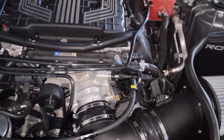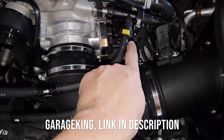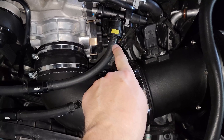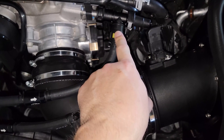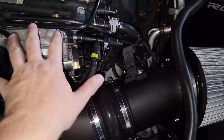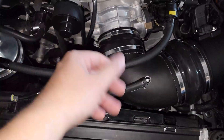Then you want to tap in off the brake booster line. I didn't want to hack into my stock hose so I could go back to stock if I wanted. I picked up from a guy on YouTube a set of quick connects that snap in here, tee into another quick connect going to the factory connection, and have another quick connect with a hose barb. I installed it here into the quick connect, which snaps into place. If I need to, I can disconnect it, remove the quick connect fitting, and buckle the factory piece right back in — I haven't spliced or teed anything like the directions mentioned.